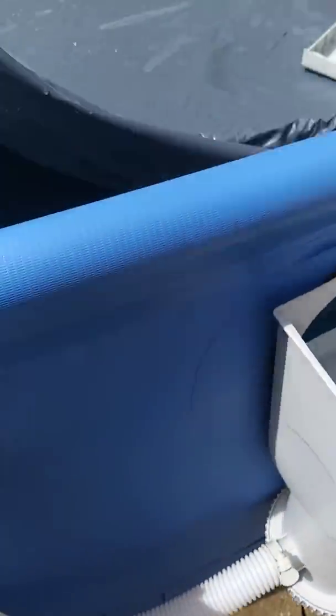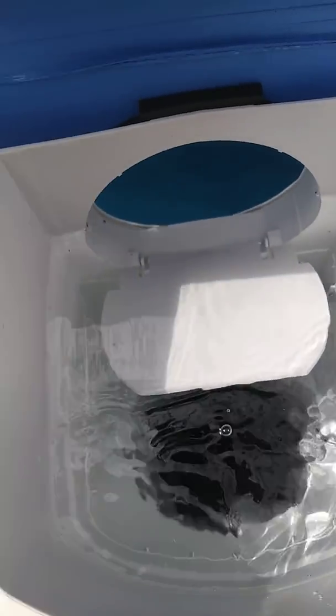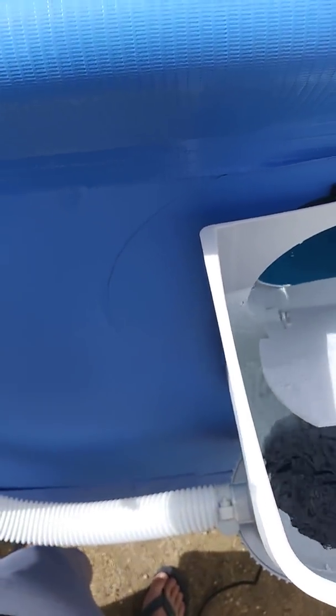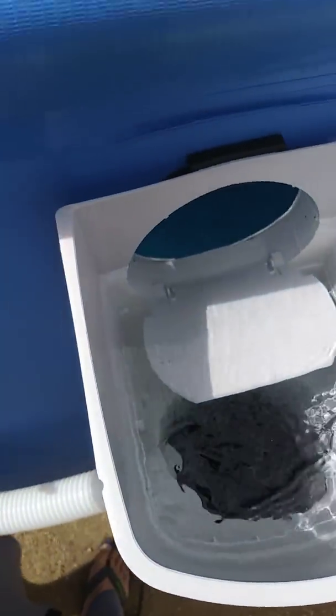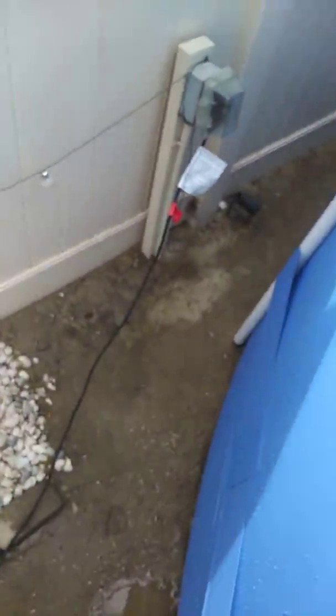It's circulating the water — a simple fix of just changing out that ceramic rod. It was a $3 part. If you go to the manufacturer's website, they charge around $30 for the whole rotor assembly when you just need this small $3 part to fix it. I cut the brass rod with a pair of wire cutters and it cut pretty easily.